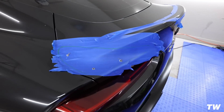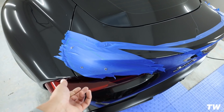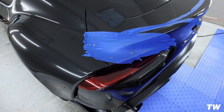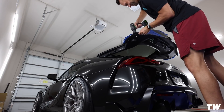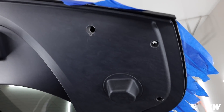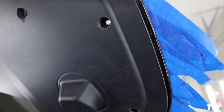You'll feel it right when you drill through - the bit for layer one is going to go through really easily, and then as soon as you feel that plastic underneath give it a stop. I'm going to pop the trunk and hoist it up a little bit with my fingers and then go through, just to make sure I'm not damaging anything underneath. Let's put in the larger bit now and smoke through the actual plastic. Got these opened up - it's going to do the trick, though I might have to go even wider to fit the washer.